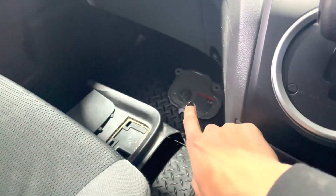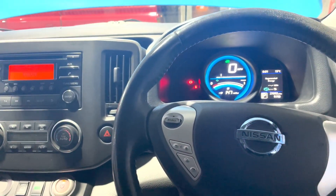Now I'm going to put the cover back down, get all the trim back in place, the under tray, and put everything back together. That's the upgrade pretty much complete. The new 40kWh battery was £5,000, and I'm planning to sell the old battery to get money back. The van went from a 50 to 60 mile range up to about 140 miles of range. I did the whole job in two evenings after work — about four hours of work — with all the right tools. Easiest battery swap I've done.